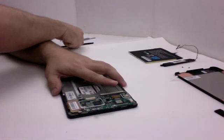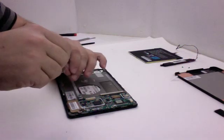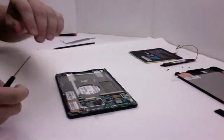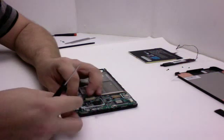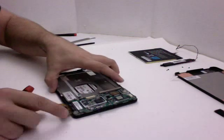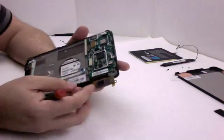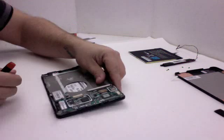These are the biggest Phillips head screws I've seen inside this device so far. The Kindle Fire, along with some of these other tablets, has followed the lead of the iPad 2 and is boasting a dual-core 1 GHz processor. Looks like there's some kind of video processor on the back of this cable that may be tied to the video output. There's also a chip here that looks like it says Illitec — it should be interesting to research what that actually is.